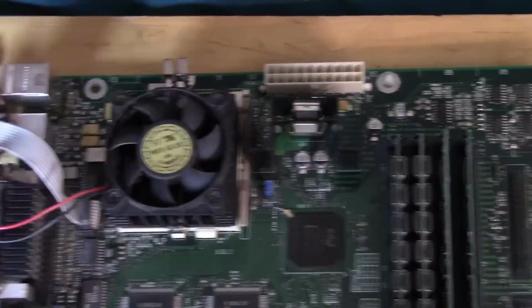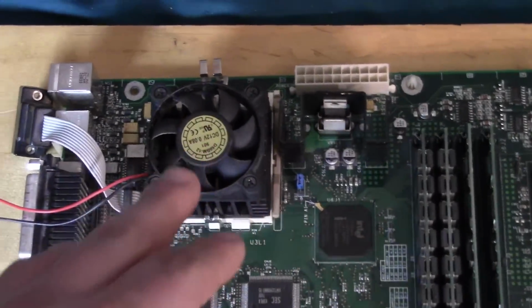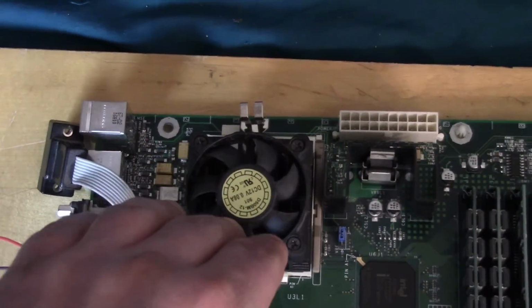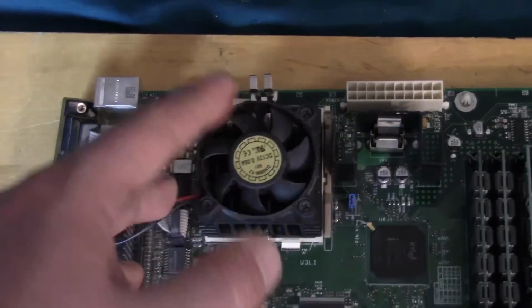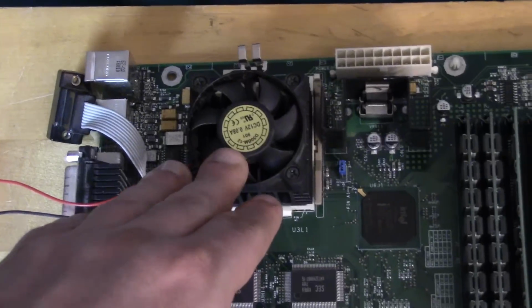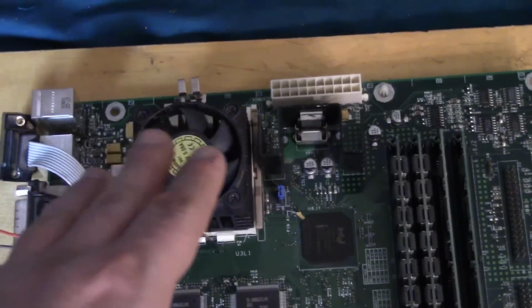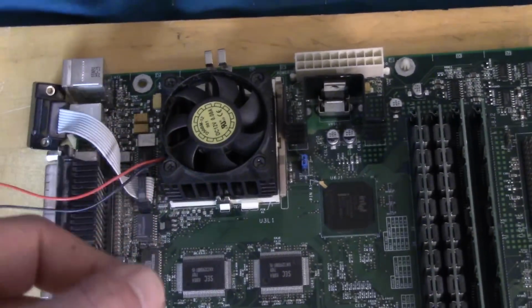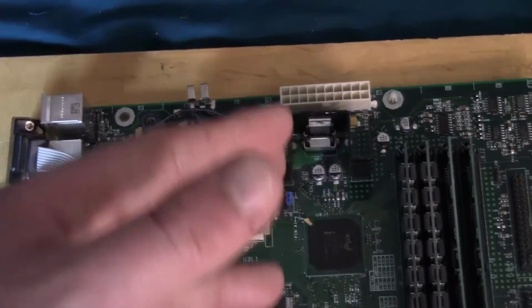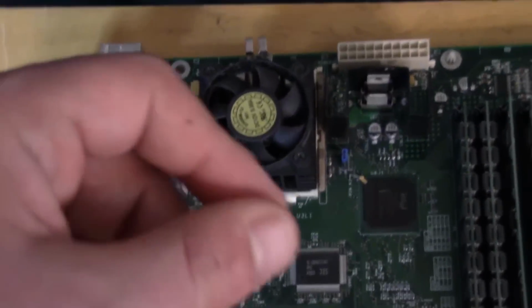You can throw in a 75 megahertz Pentium if you want something a little more old-timey, something that might mimic a really high-end 486. Or something more reasonable, a 133 or 166 megahertz Pentium. Those are classic Pentiums, great jack-of-all-trades CPUs for DOS. Yes, even with the 75 megahertz Pentium, you're going to have games that run too fast. DOS just covers too wide of a spectrum. The farther back you go into the 80s, you're going to have games running too fast. Even in the 90s, you're going to have some games running too fast.